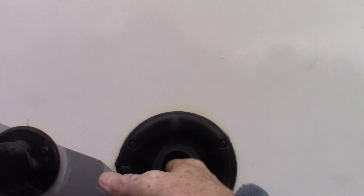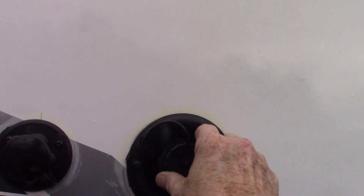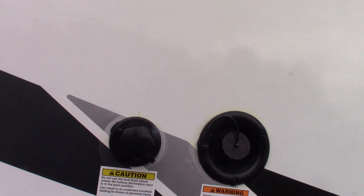This is your fresh water fill right here. If you don't have city water — city water is the most common way to get water to the trailer — but if you're camping somewhere without city water, out in the middle of nowhere, you can pre-fill your fresh water tank here and then use the onboard pump to pump the water. All the plumbing will still work as though you had city water; you'll just be pumping from the fresh water tank. I'll show you that when we get to the switches.